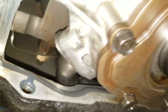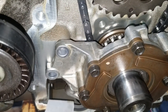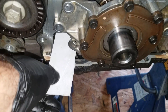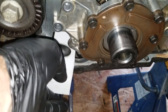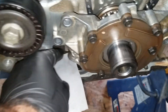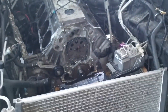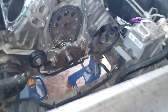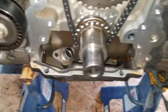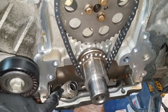Just to show you guys what I did — I removed that bolt that was right there. To prevent it from dropping into the oil pan, I just had a piece of plastic that I wedged right there, and then I worked on it with a wrench and removed it with my fingers once I got it a little loose. Just something to help me out a little bit. So let's see if I can wedge something in between there and get that oil tube out. Luckily I didn't have to wedge anything in there — I just literally grabbed the oil pump, twisted it a little, and it just popped out. At that point I just grabbed this with my finger, pushed it down slightly, and it was good.